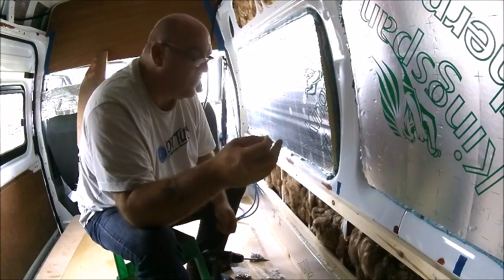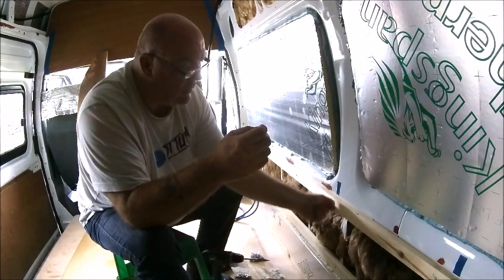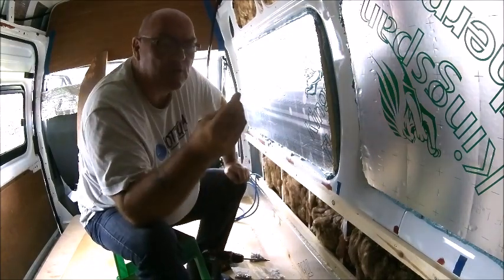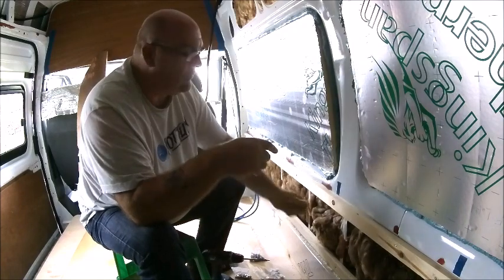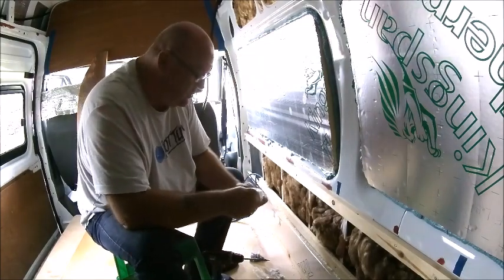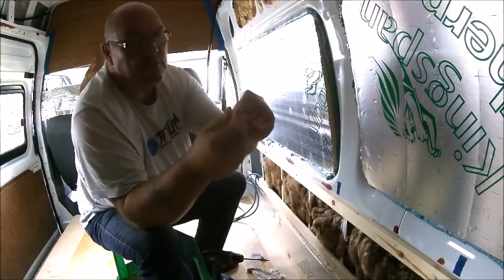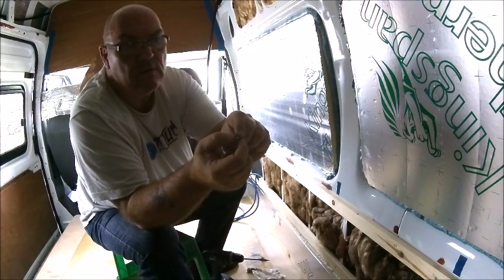anti-vibration washers. I mean, everything's vibrating, particularly when you come around to do your electrics, because apparently, according to the electrical installer's website, the biggest cause of fires in connections is loose connections. But just for the fixings, I'm going to use these anti-shake washers. And just to make extra doubly sure, I'm also going to use the nyloc nuts, which I did with the other batten. The nyloc nuts are the ones with the rubber inserts in, so that as you tighten them up, they're also not likely to come loose.